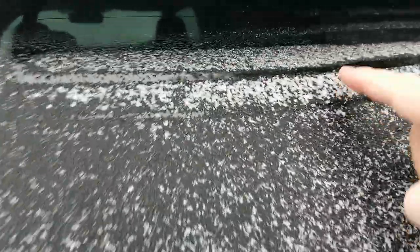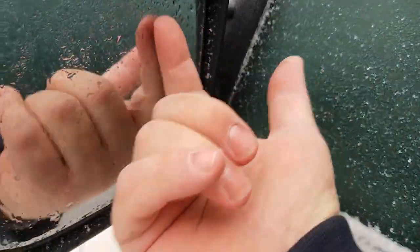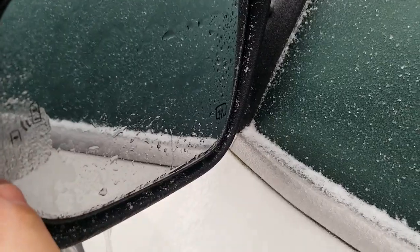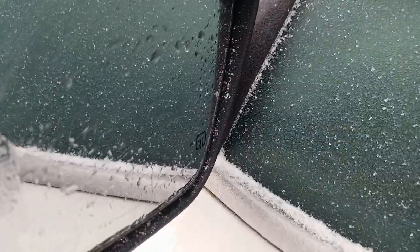I don't have the heat turned on in the car — I did that on purpose, and I want to show you why. But if you look right here, you can see that your defrosters are working. The thing under the windshield wipers on the front is the same as this. And you can see this is water right here. Where I'm at right now, it is 20 degrees. So I want some props — I'm out here doing this for you guys. The heated mirrors — this is water, this is still ice right here. So it's not cleared all the way off yet. I didn't do anything other than start the car and turn on the rear defroster. The rear defroster is what actually turns on the mirror heater.